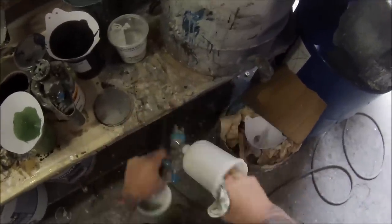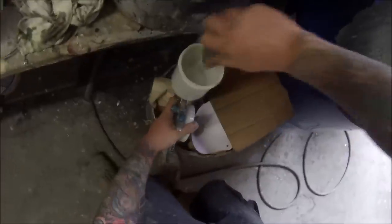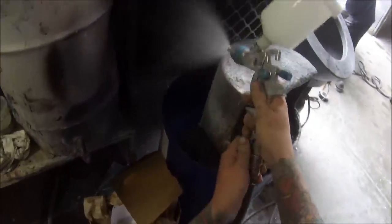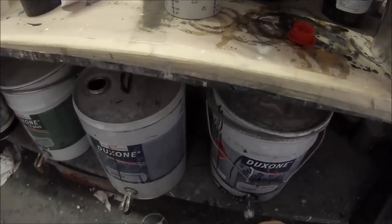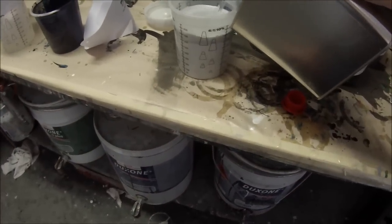Just putting our 1K etch on now — you don't have to go full heavy, just a medium wet type coat. Since making this video I've started listening to some of you subscribers and I do actually now wear gloves, so I've been doing it for the last couple of weeks. Thanks for your feedback on that — it is valued. I look at myself in this video and think how could I do that. And you see that spray gun there — it's a $45 spray gun and it sprays like a $45 spray gun. It's crap to be honest. It's spraying off to the right. I actually regret it — I think $45 is too much for it. You get what you pay for.